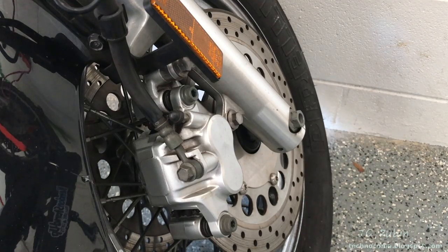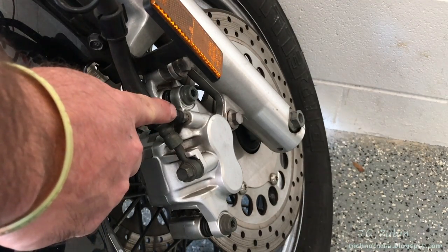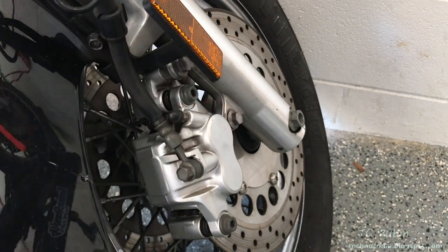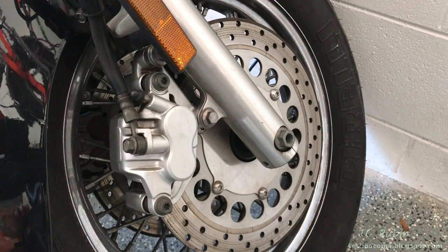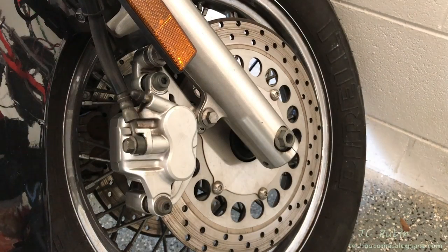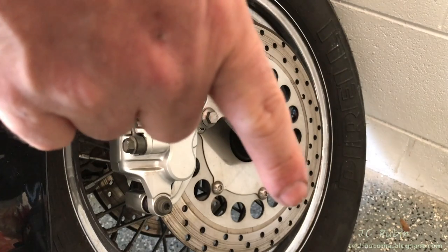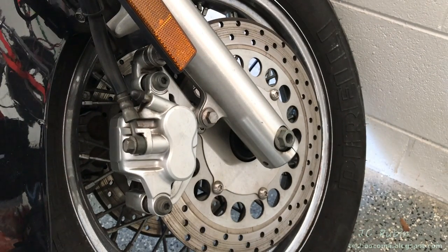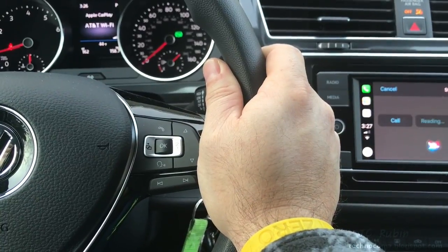After the front brake pads are serviced, the brake system in the front should definitely be bled — a link in the top right corner will take you to a video on bleeding the front brakes on a V-Star 1100. The feel of the brakes and the ability to hold the wheel should be adequately tested before attempting to operate the bike. That concludes our video on the replacement of the brake pads on the front of a V-Star 1100. I hope you found this video enjoyable, entertaining, and informative — hit that like button and subscribe to be notified about more videos like this.